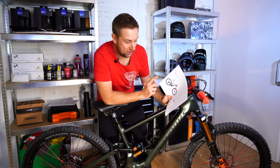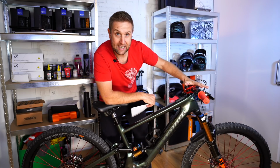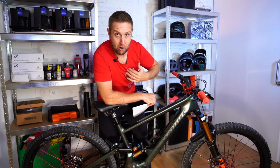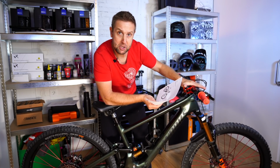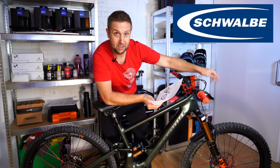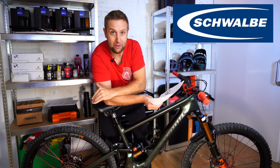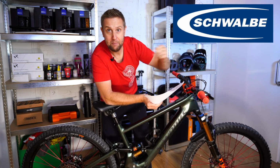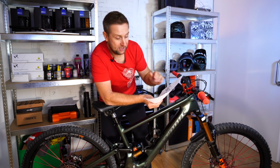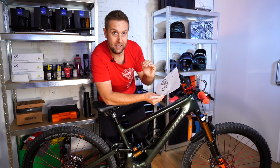And now with the tire pressure, Specialized says 26 to 30 on the back and 25 to 29 on the front. I would say at 83 kilos with all my riding clothes, that's what I put into the calculator. It also depends on what type of tires you're riding. With the Schwalbes, shout out to Schwalbe, the sponsor of the channel, I go 24 on the front and 28 on the back. That's my go-to, but that's with a Super Trail casing on the front and a Gravity casing on the back. So definitely 26 to 30 and 25 to 29 is around the ballpark.